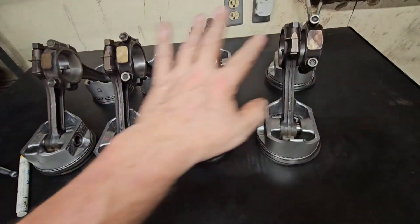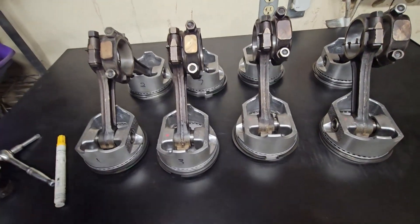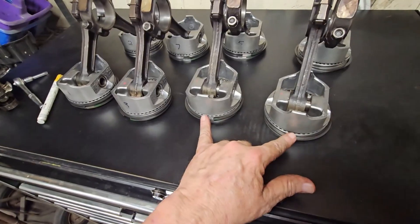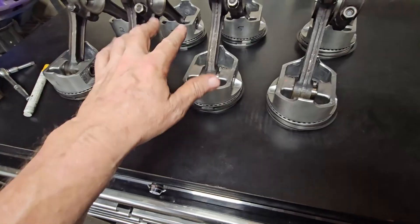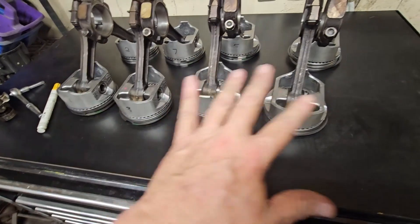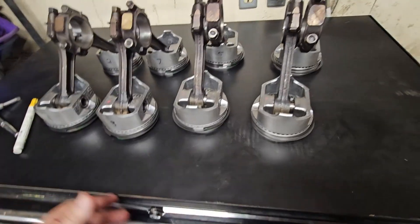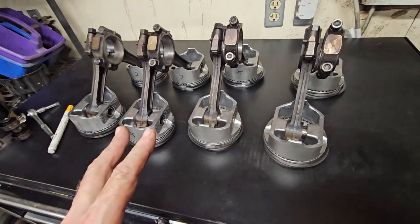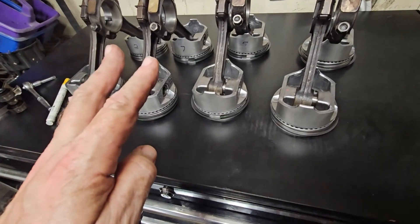This is fresh recon, so it's not necessary for them to go back in a specific order - it just caught me off guard when I noticed it. I don't like it, but now I've got to change these rings to whichever hole I'm going to put them in. I haven't changed any rings out yet but I've got to move rings to make them match the holes, which is more time consuming but pretty easy. We'll get the little tool back out and just pull them off and swap them, but it's going to be tedious - one at a time to make sure everything goes back where it's supposed to.